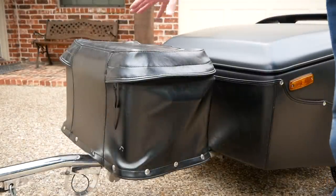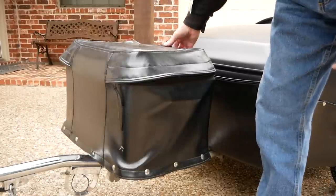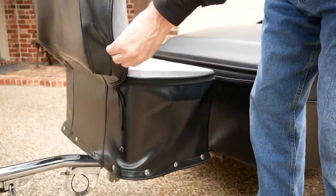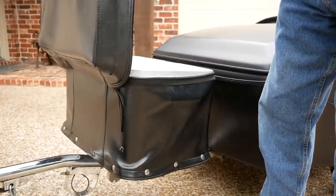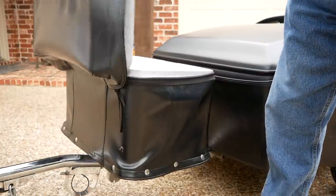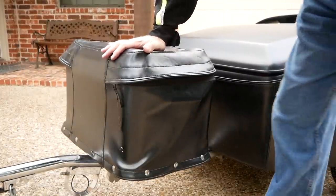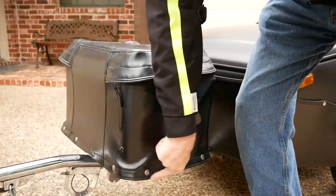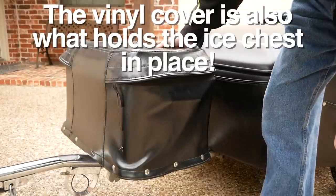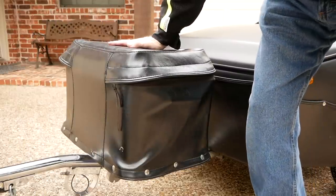On my Bush Tech I have an ice chest with a little vinyl cover on it. I like to mount the ice chest backward so the door opens away from the direction of travel — if I forget to zip down the cover, the wind will always be pushing it closed rather than catching it and blowing it open. Make sure your little snaps are snapped down firmly too, because you don't want the cover to blow off at highway speed. Secure your ice chest properly regardless of the type of trailer you have.